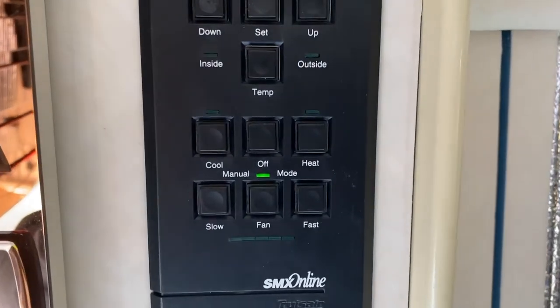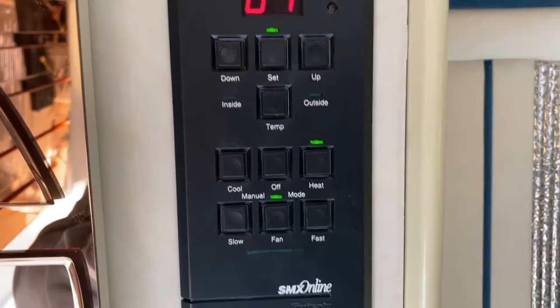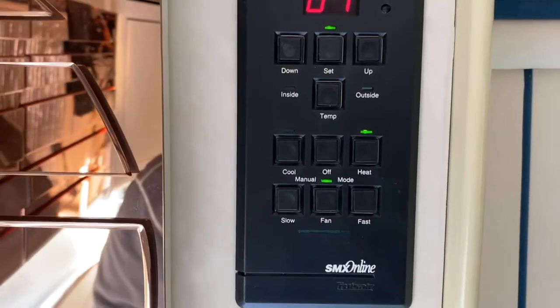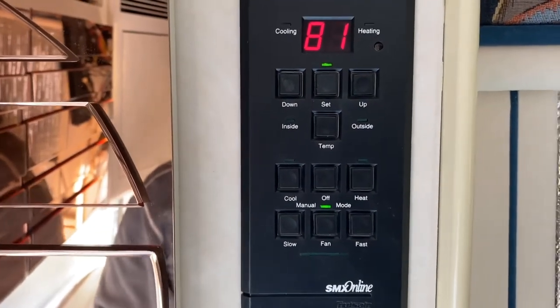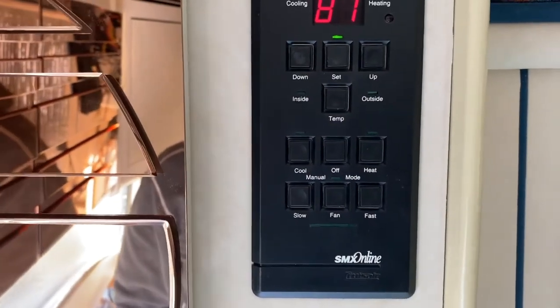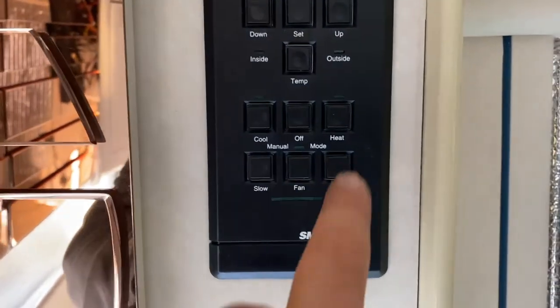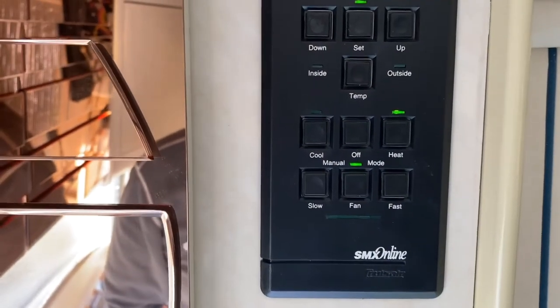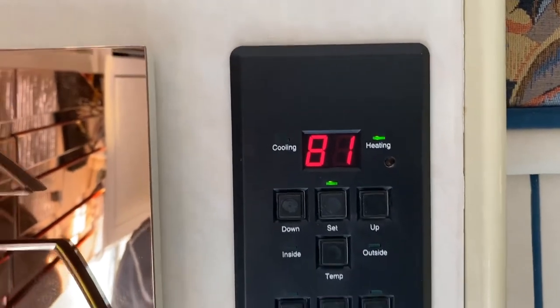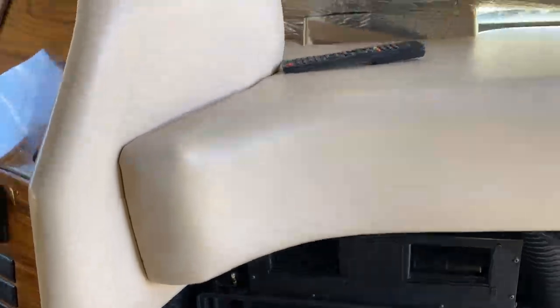On a Marathon, you can see how that little heat light is flashing. What you have to do to make heat come on is tap that button twice rapidly — it'll start flashing and then up there it'll say 'Heating.' That turns these fans on and it starts to demand that the Webasto come on.